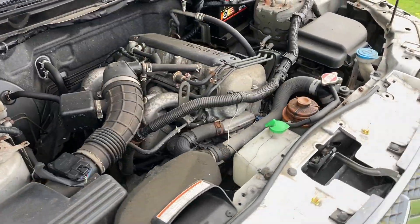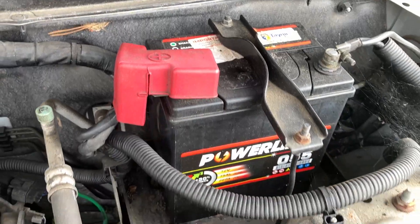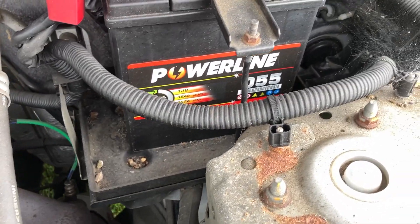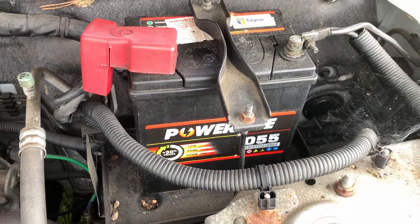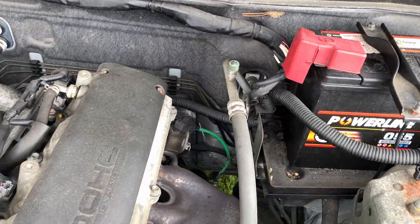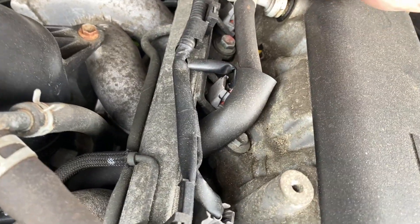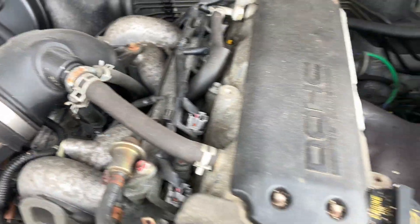I've popped the lid — it's a baby little battery compared to the truck. It's a 35-amp unit; the truck's was probably twice the size. So you won't want to park up and run off that — you'd risk running it down. And you can see the injectors here — this is where we're getting the noise. Maybe some ferrites on there might help; you can but try.